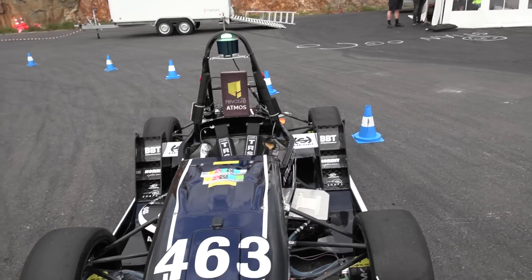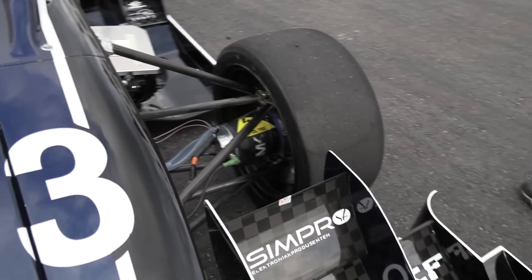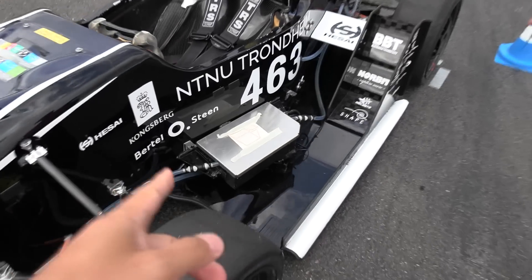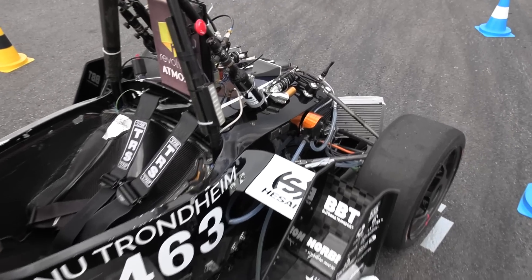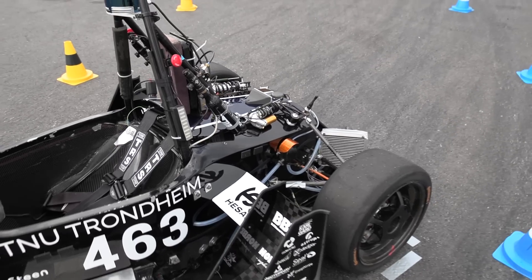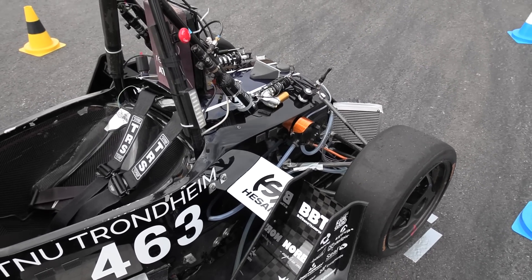So it's an electric car with four motors, one in each wheel hub — you can see them here, they're directly connected. The gearbox is inside so it's very tightly packed. There's a computer on the side of the vehicle; usually it's kind of hidden but now we're just testing so it's shown outside. In the back, packed inside the monocoque, is the inverter and the accumulator or battery pack. We're running about seven kilowatt hours and 600 volts — there's a lot of power.